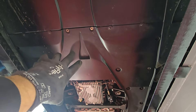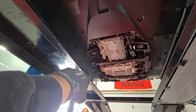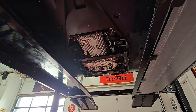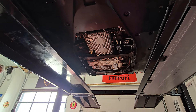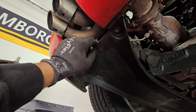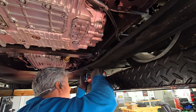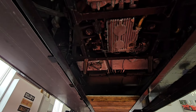The next thing we're going to do is remove some panels down here — this panel, the one back behind it, the two on the sides. Then we'll work on the exhaust and drain the coolant. On this back panel you've got two fasteners — one here, one there, same on the other side — these are tens, and the forward ones are eights. Where Mark's working, those are all eights. So we've got both under-trays removed.